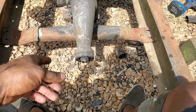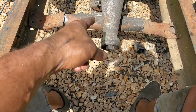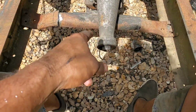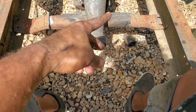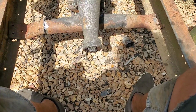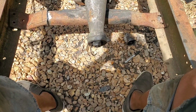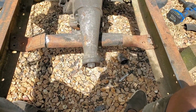But you know, like I say, I'll put a jack board. I got the big 8x8 right there. I'll put that underneath it, or that's probably a 6x6, whatever. But I'll put that under your jack and jack it up just a little bit, and then I could go ahead and weld everything together as well as fit my holes for the frame so I could get all that drilled out and get this wrapped up. So, home stretch time.